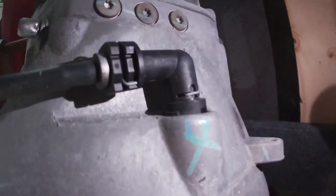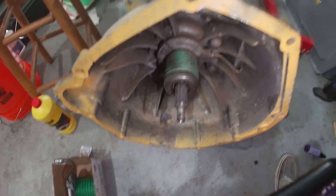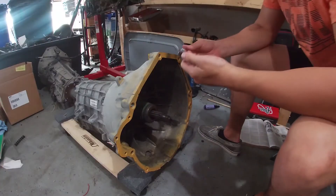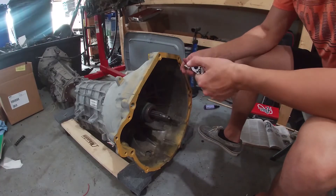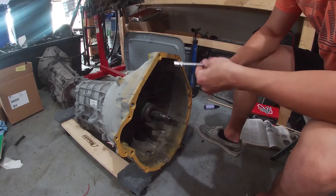So the next step — it looks like I have two bolts on either side to remove it. For the part that goes into the transmission, this wire, I believe, is held in by this clip right here, but I'm not quite sure yet. I'll let you guys know once I start getting into there. If you're going to use this transmission, the bolts holding the slave cylinder in are 10 millimeters.